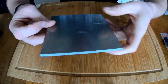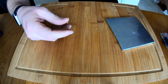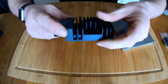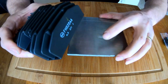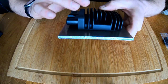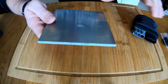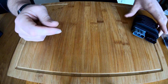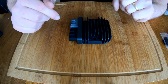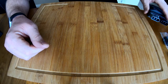I also have a piece of 5mm plate aluminium. What I'm going to do with this is make a mounting plate to fit this to the bike, because being a non-standard Honda item, this will not bolt straight up — the holes will be in a different place. Because it's made of aluminium it will also act as a really good heatsink, taking heat from the regulator into the frame and dispersing it over a wider surface area. That will be done in a different video. This will be a series of three videos: this one where I make the loom, one where I make the mounting plate, and one where I fit it to the bike.